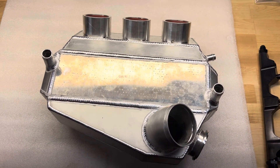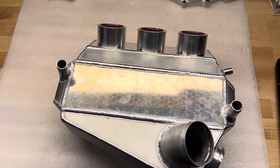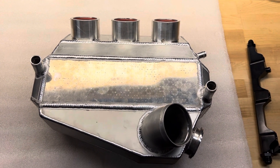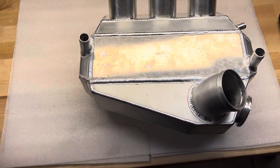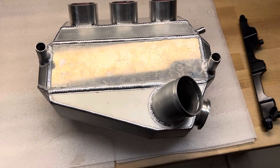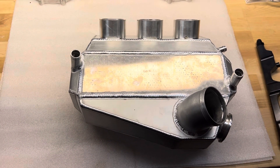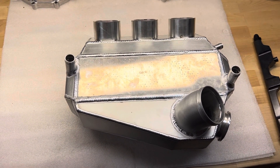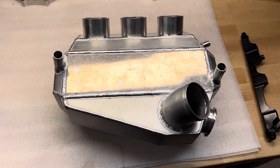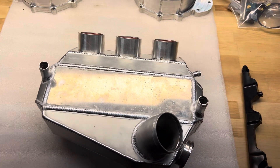We do sell the Johnson-style brushless water pump, which is my go-to. It's been my go-to for street vehicles for a long time, and it works good on this Yamaha. Very low current draw, very high water capacity — it's a really good match for one of these water-to-air systems. And then in the front of the car you're going to have a heat exchanger, whether it be a 2016-to-2018-style OEM radiator, or we're going to offer a bolt-in large-size heat exchanger for the 2019 and newer platform. But that's still in the works.